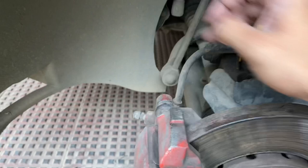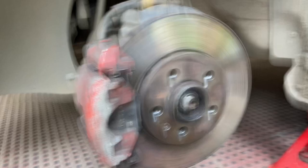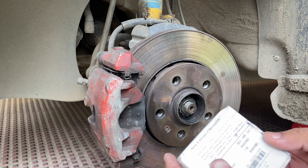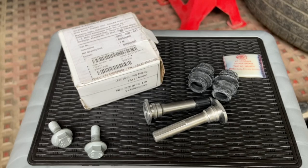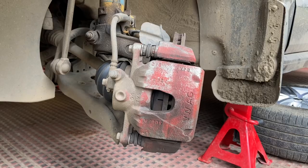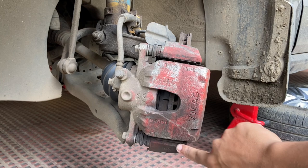It's a good idea to change those components when you're doing the brake pad service, because it is available as a kit for around 880. I'll give the part number in the description below. This is basically your brake pad service kit, also retailed as the bushing kit. You get two bolts with guide pins inside, two bushings, and the brake pads.